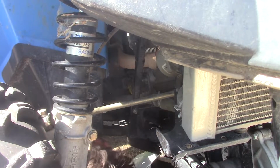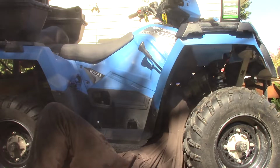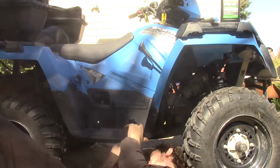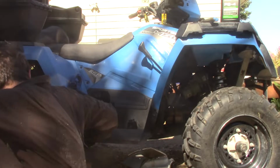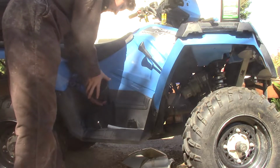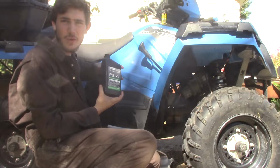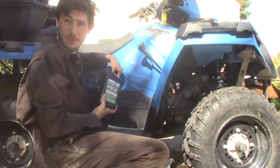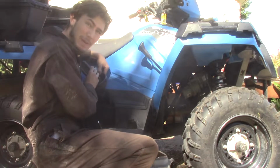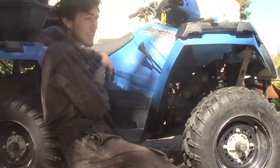Oh, now I gotta crawl out here. Oh, that's not fun at all. Not at all. Let's stick our nozzle in. Start pouring in some oil. Now, the amount of oil you get from the kit should be enough to fill the machine. So just be careful on that. I will tell you this, funnels, especially funnels with extensions, help out a lot. Especially on ATVs. On trucks and vehicles you can get away with it, but on an ATV you can't get away without having it. Otherwise, you're just going to be swearing and cussing the whole damn time.